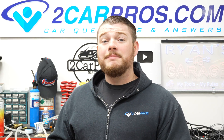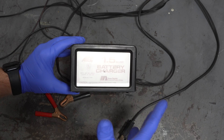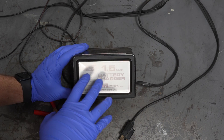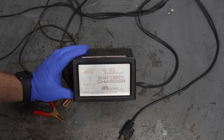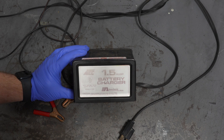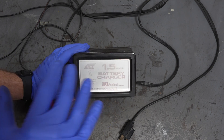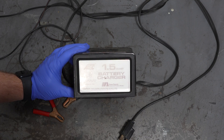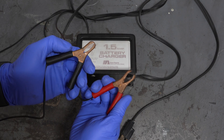This is a typical battery charger you can get pretty much anywhere. This one does 1.5 amps — that's how much electricity is being pushed into the battery at a given moment. They do make more powerful ones, up to 6 and 12 amps, but there are trade-offs. A more powerful charger crams more electricity into the battery at once, which can affect the chemistry inside and degrade its life. The downside of a lower amp charger is it takes a bit longer, but I think that's worth it to keep the battery fresher. There's a link in the description below.